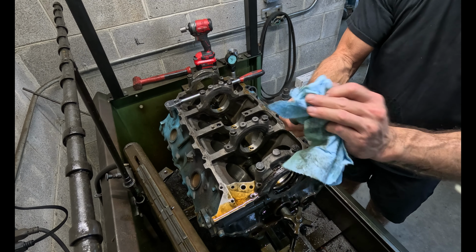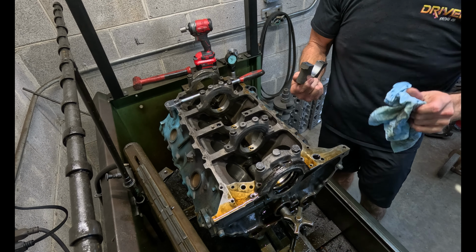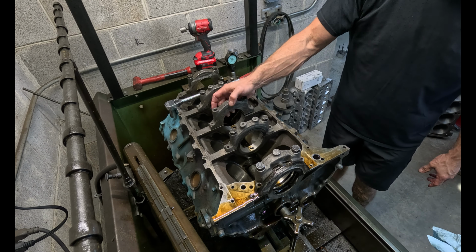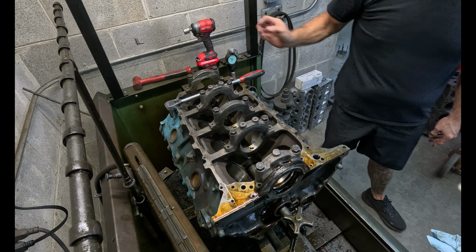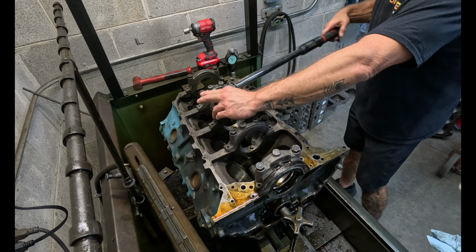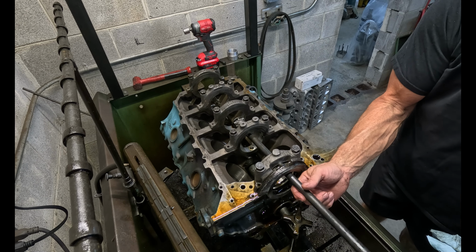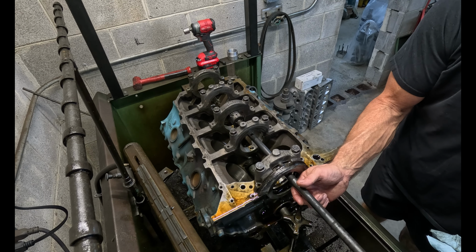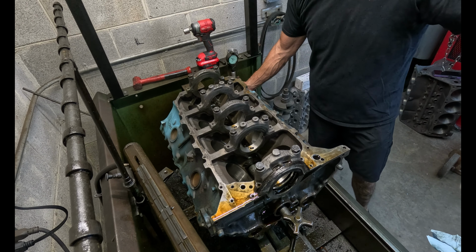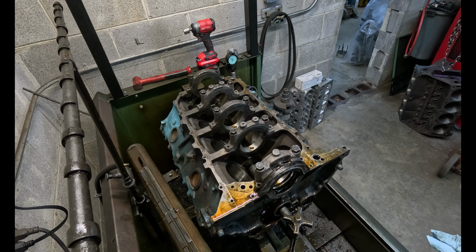So I think we probably trim 1,000ths off of it and be able to bring it in. But like I say, the rest of them look good, just this one's a little bit big. Maybe in that shadow it's still just like a tenth or two small, so it may take a pinch more.